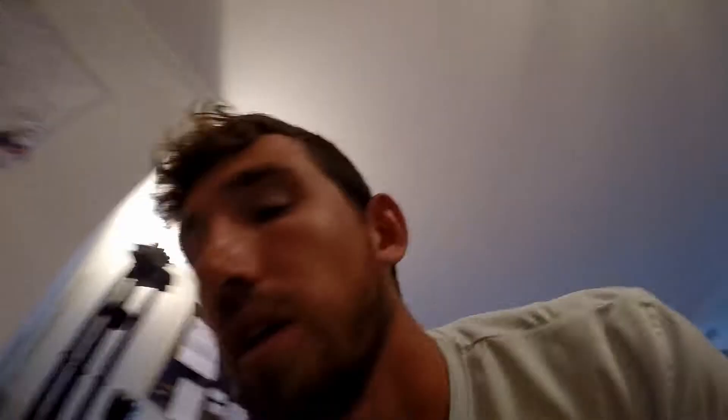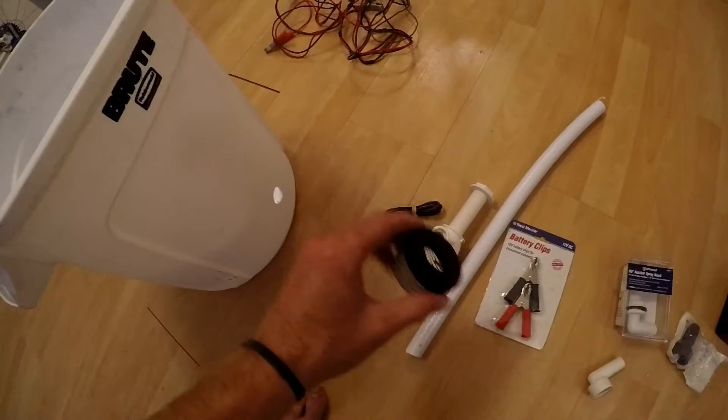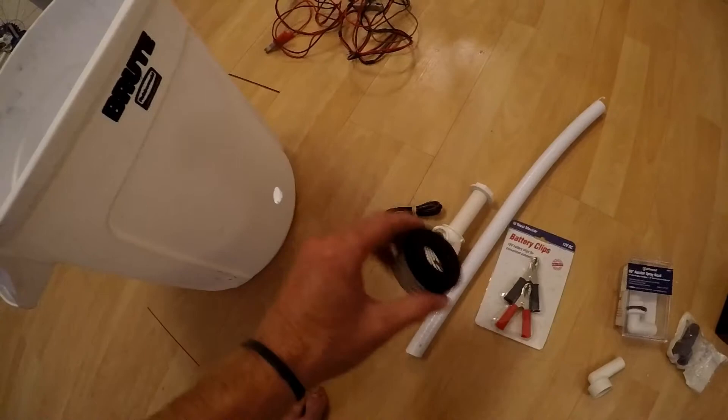First thing you're going to do is take your drill and drill a hole in a good spot. I already drilled mine and I kept it a little bit above the bottom for two reasons. One, the pump fitting is pretty wide and if I put it right on the bottom it wouldn't work. Two, if you ever have sand in your bait well, it's not going to suck up the sand, and scales, seaweed, or dead fish that settle to the bottom won't get pulled in. I kept it about three inches up from the bottom — that prevents clogging and keeps the pump recirculating better quality water.